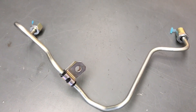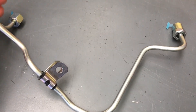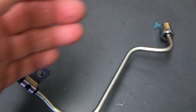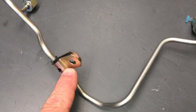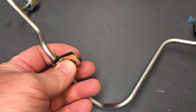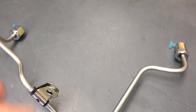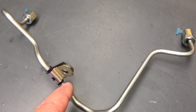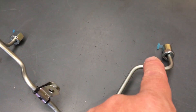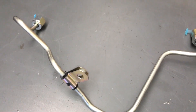What we do is install the number four fuel pipe on the common rail and on the injector, make sure it's sitting happy in place, and put this bolt in place — there's a clamp that comes in the bag, you need to use it. Get the bolt started so it can't move, nip these up finger tight, then torque them up to 32 Newton meters each. Then double-check the bolt — should be about 5 to 10 Newton meters, but don't forget it.